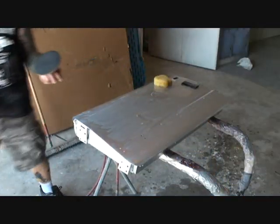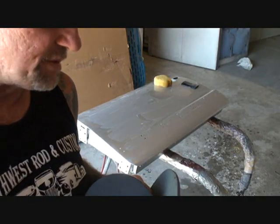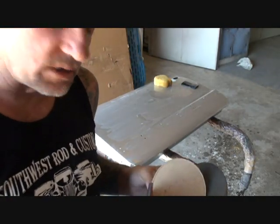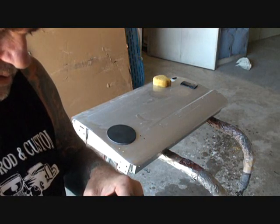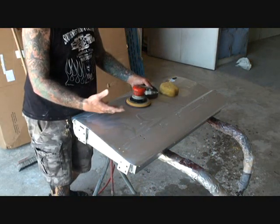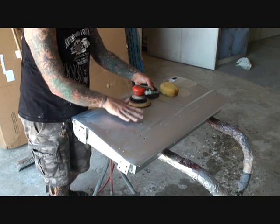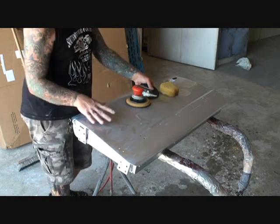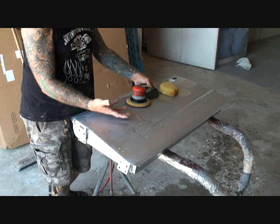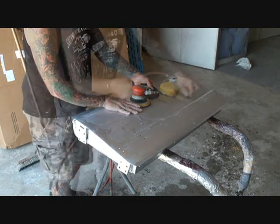But hold on — we're not done yet. What I'm going to do to really kick this in, and save a lot of time and money, is take off the 2000 grit and go ahead and put on 4000 grit. Taking it down to 4000 is actually polishing the clear. If you look at my hand, you can see my reflection. I want you to pay attention when I get done sanding with 4000 — look at the gloss it already has and the time and expense of buffing compounds you're going to save by taking it to 4000.